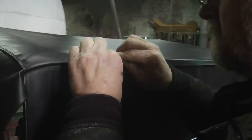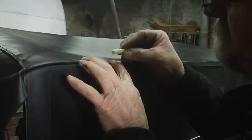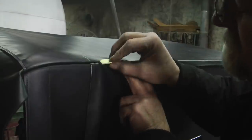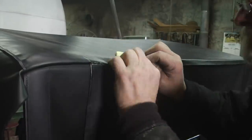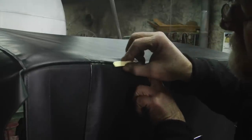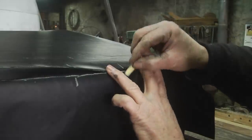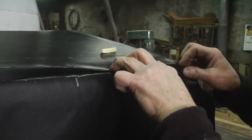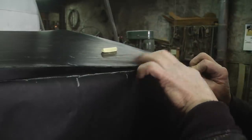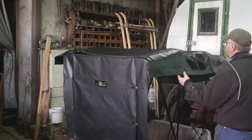First I'm going to sew the rear curtain into the back of the top deck. The original one was actually hand sewn, but I don't like that style — one, it's way too much work for my fancy, but this machine stitch makes a real watertight seam on the back curtain, so this is what I use. If this were a top where the main concern was being authentic, I would go ahead and do the hand-stitch seam.